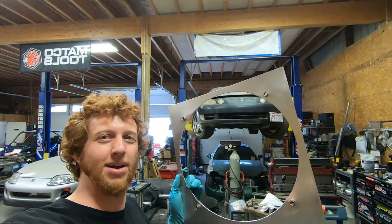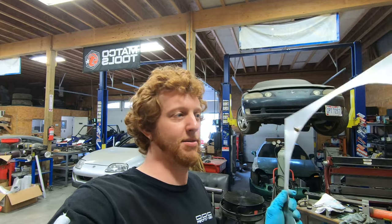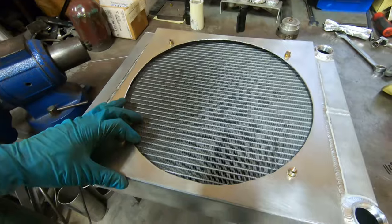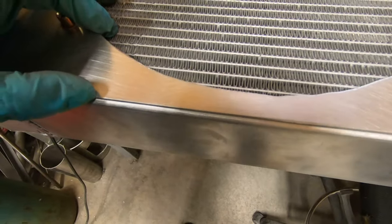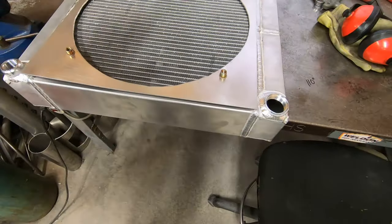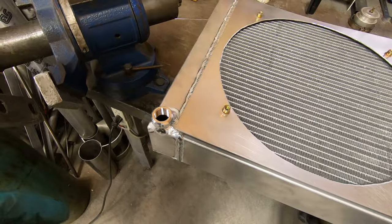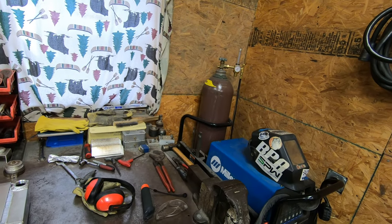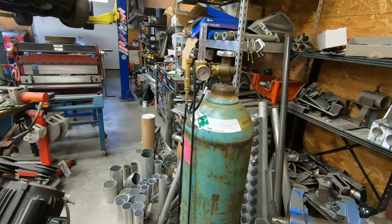We have our hole — not the prettiest hole in the world, but it does not impede the fan, so that's what we were going for. I went ahead and put a little bit of a brushed finish on it to get the raw aluminum look off of it. All is well and we're about ready to start tacking. There's a little bit of hangover here and up top when it's equalized, and the shroud is a little bendy right now, but I'll clamp it before I start tacking and all will be well. I need to swap my gas bottles — that one has about a hundred PSI left in it and this one has much more, so we don't need to purge aluminum. I'll swap the bottles and we can get to tack welding.